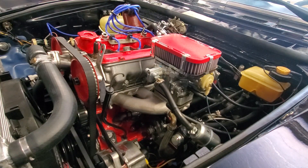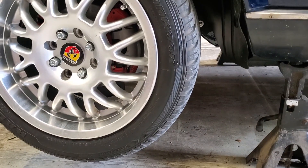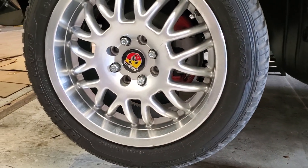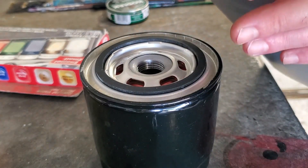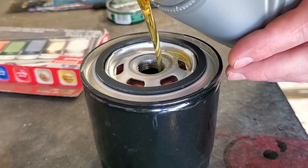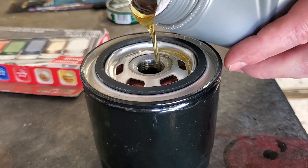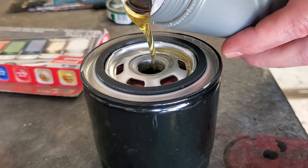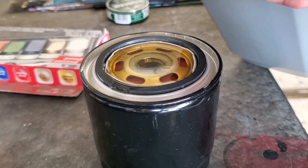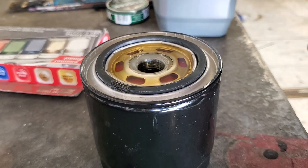I'm going to take it out and drive the piss out of it for a while. The first thing we're going to do is put the car up on jack stands, because if you put a center floor jack under there and raise it up, it's right in the way of the drain plug — I think they did that on purpose. We're going to pre-fill the oil filter with oil. If you poke a little hole in the top it won't splash everywhere as bad. That's going to drain down a little bit, we'll come back and refill it.